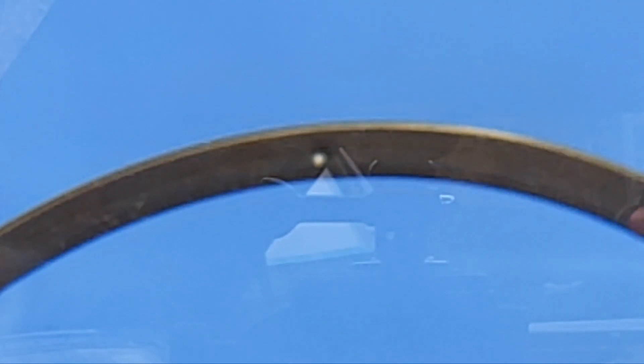This is 2618 alloy. That divot on this side puts a bump on the other side, and that bump in the normal running position in a vehicle goes down. If the engine is upside down and you're working on it inside the shop on the engine stand out of the vehicle, the bump would go up — but don't get confused, just use the normal position that it's in the vehicle, so it would be facing down in that configuration. That's it, it's right there.